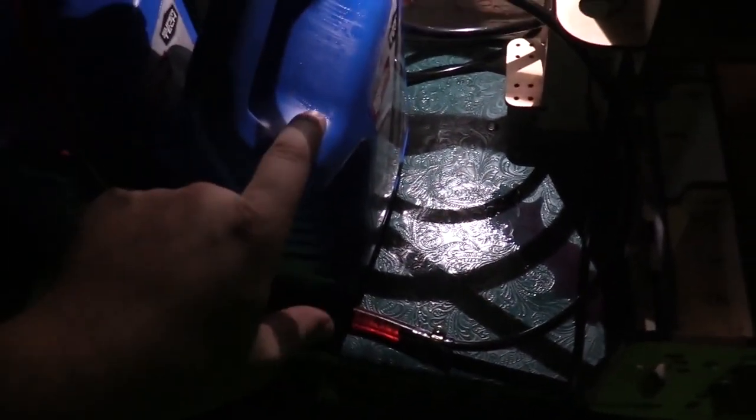My theory is that the little black tip that it came with had too much girth. What that meant is as we were trying to push transmission fluid into the pan, it was just pooling up around the inlet, the overfill, and coming back out, so it looked like it was full. But I don't think it's full, because that pan is about the size of this, and this is going to allow us to verify, in fact, that it's full.